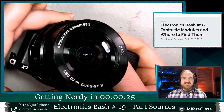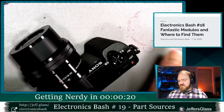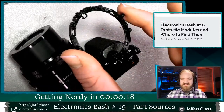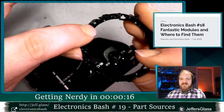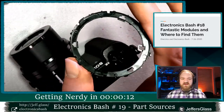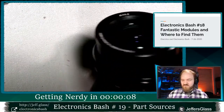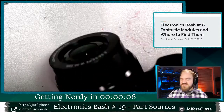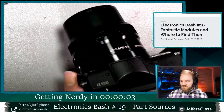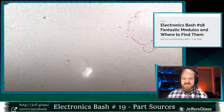These kit lenses, these OSS lenses that come with the camera, are known for breaking. Specifically, they have this little plastic ring that is basically the midpoint of the lens where everything else attaches. And this is the broken one that I pulled out and replaced with an unbroken one, and something is still not right. So this camera, though it is functional, doesn't focus, which makes it not a great camera for anything you actually need to see.